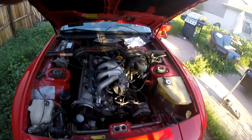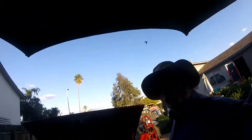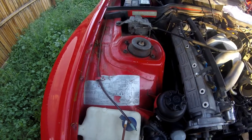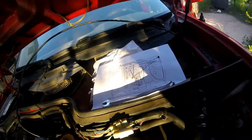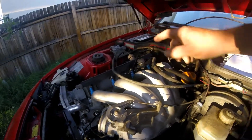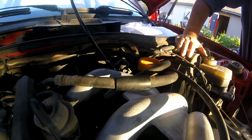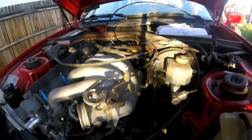I would like a black T fitting, but most of the aftermarket ones are white — that'll stick out like a sore thumb. I actually think we've gotten most of the vacuum in. This vehicle does have a chart right here on the fender — part of it's missing, of course — and for those of you that are mechanically inclined and have been working on these, you know that these are vague at best. My paper copy is probably better. This switch goes down to a three-way port, which goes to the splitter, which goes to the fuel rail. This one goes across and down to one side of that two-position port up underneath the intake manifold, and the other side of that port goes to throttle body vacuum right here.